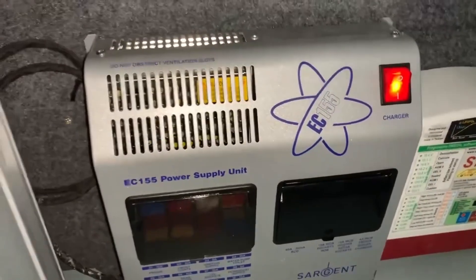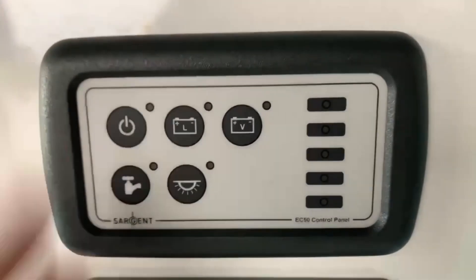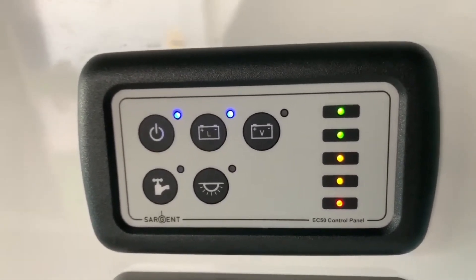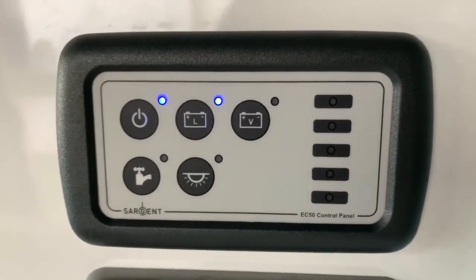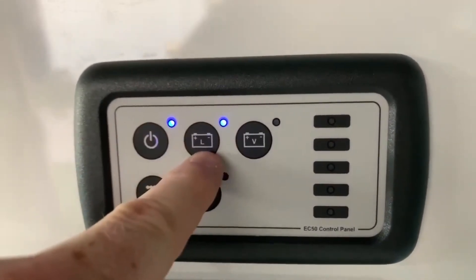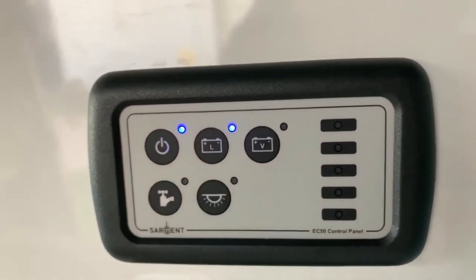This is in communication with the control panel itself, which is the EC50 panel we can see right here. So what we then have is the ability to turn the power on here. If I press that, you can see the LED next to the power button illuminates. We also see this button illuminate, and we also temporarily had a display there on the LED segmented display. Now these two buttons are for selecting and viewing the battery levels — here is the leisure battery and here is the vehicle battery, distinguished by the L and the V within the battery symbols.